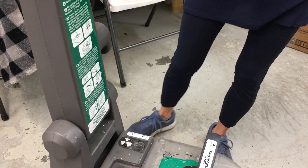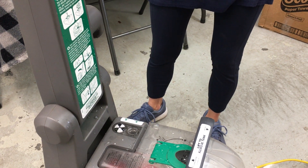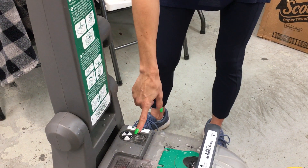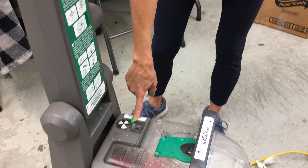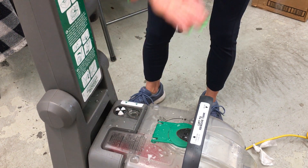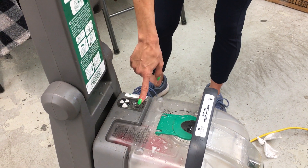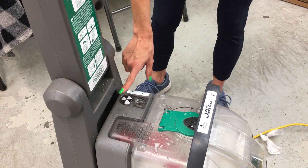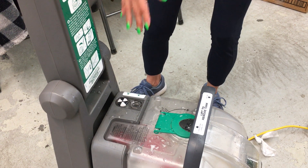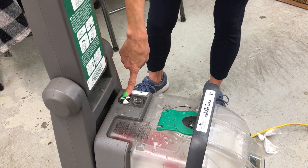You will notice that spray did not shoot up and stay up 6 to 8 inches high. The reason is because one of the very first things we were able to identify — that flow indicator — is failing. We knew it because as soon as we turned it on, water started coming out of there before I even depressed it. The spray on the pump was pretty good, but it's not going to stay up there as long as the flow indicator is not solid in the machine.